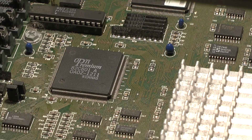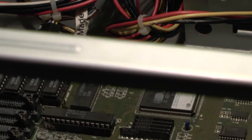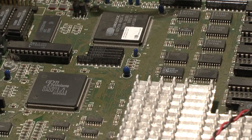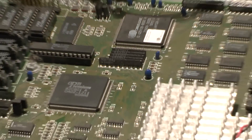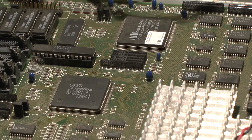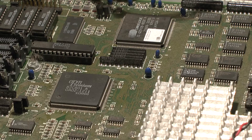The integrated video card in them is a Cirrus Logic CL-GD 5428 — same video card, same chip. That particular Cirrus Logic video card with the support of one megabyte of RAM on the motherboard is very good. You can get versions that have two megabytes, but not on this particular board.